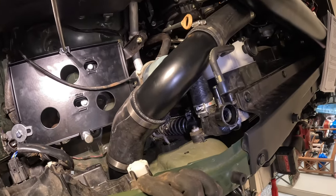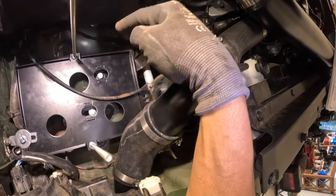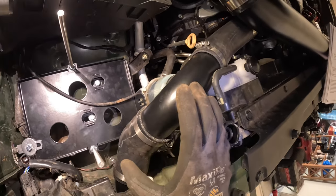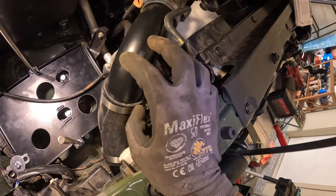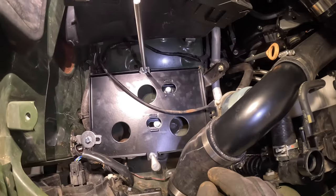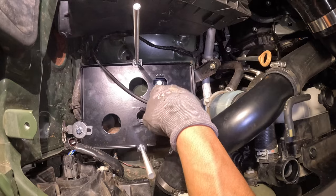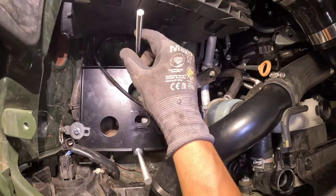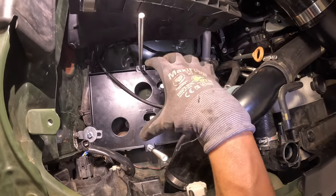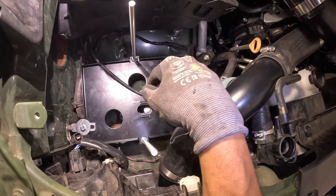My suggestion: if you can, do the battery relocation before you do the intercooler — that way you have more space to work freely. I took off the upper radiator hose just to make some space for the power steering reservoir. Other than that, there's two bolts here, a spacer under this part of the tray, and all-thread that holds the battery holder. Next step is putting that plastic piece back, getting the battery in, and then running the wires.